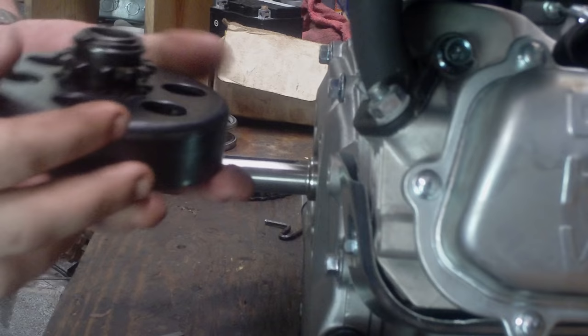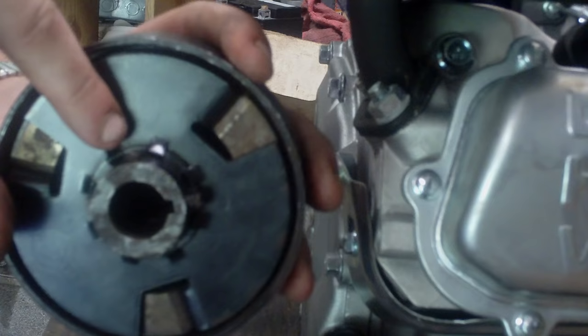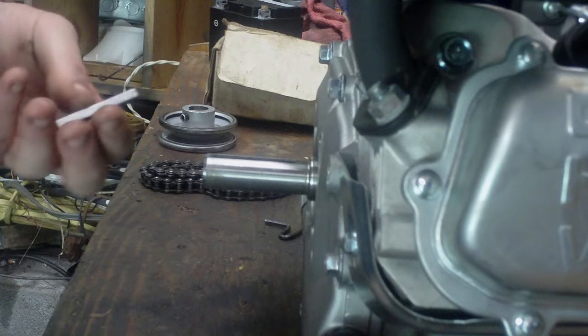Here's your clutch right here. You've got your keyway slot right here. You've got a set screw right here that screws down and puts pressure on the keyway. You've got another set screw over here that comes against the crankshaft. Make sure they're out, not in the way. Your engine should come with a keyway, but it'll tell you what size to get.